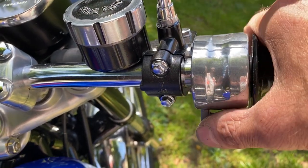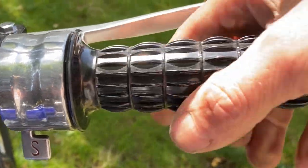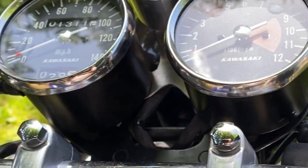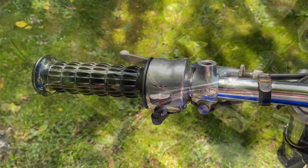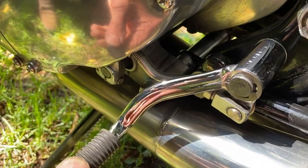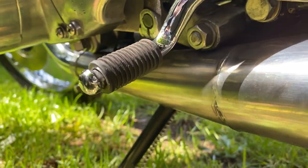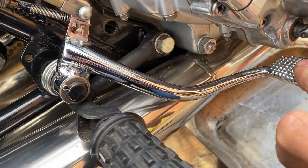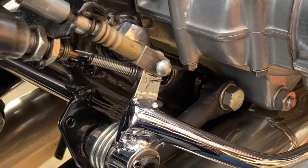The choke and throttle work well considering they're pulling up the extra carburettor, but they're still light and smooth. The front brake is hydraulic on this bike because the front end is from a H2 Kawasaki which has a hydraulic disc — the standard H1 1970 would have a drum operated by a cable. The modified gear lever works with the same shift pattern, which is neutral down, five up. The back brake fits in its original position on the same pivot, it's just been reshaped for the wider engine.